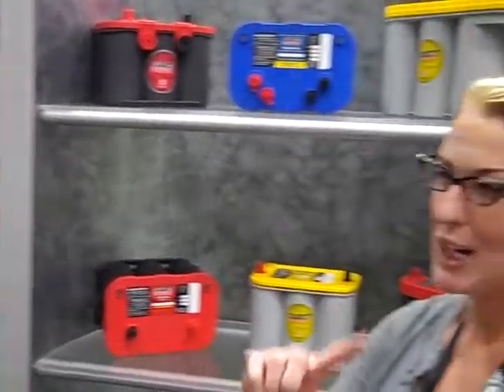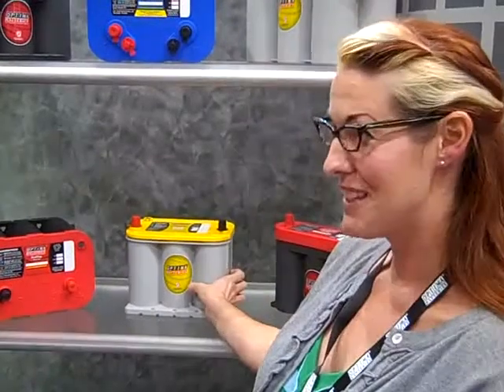What I understand is that Optima Batteries have a spiraled lead plate — they use little cylinders. And between that is a glass mat where all the electrolyte is absorbed, and that holds the charge. The glass mat is where you get the name AGM — absorbed glass mat. The electrolyte is present in that glass mat and inside the active material on the plates.